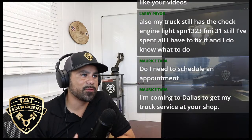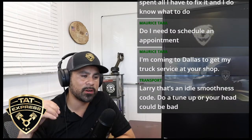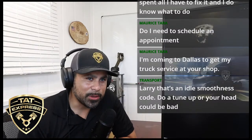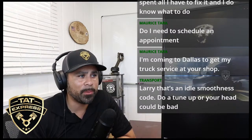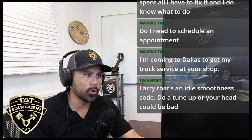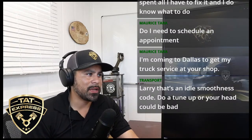As I mentioned, after 2003, the 60 series, I'm really not a big fan. After 2004, when they really started bolting on the, not the after treatment, I'm sorry, for the emissions control. I apologize. When they started bolting on and trying to control the emissions, putting in EGR coolers, changing to different style turbos, VGT style turbos, I really started not becoming that big of a fan of the 60 series. Not only did they become a pain in the butt to start working on, because now you have V-pods to deal with, and you had a bunch of issues going on with that, it starts becoming a problem.